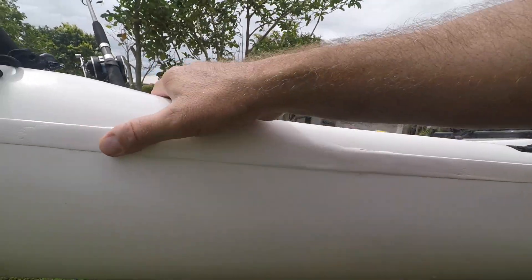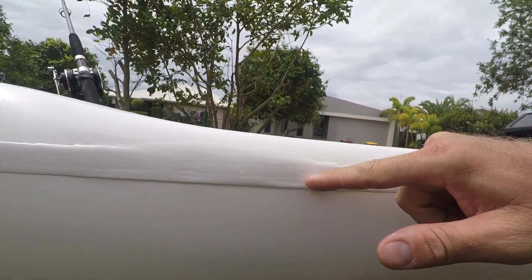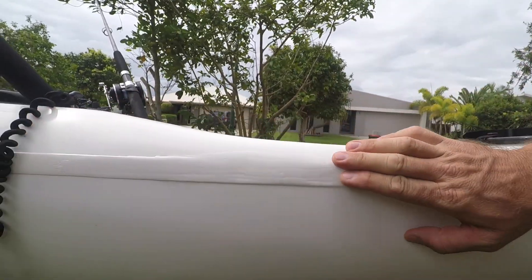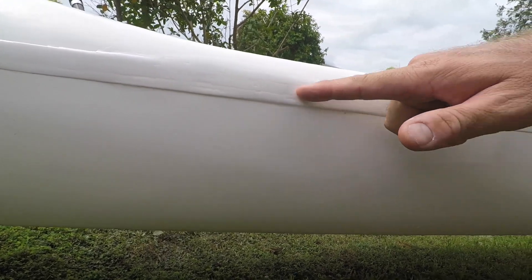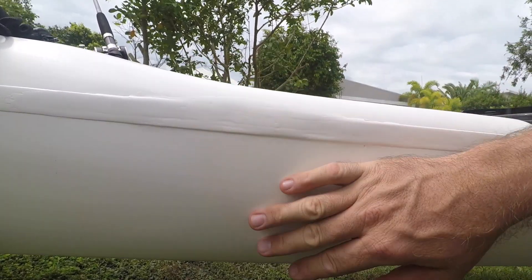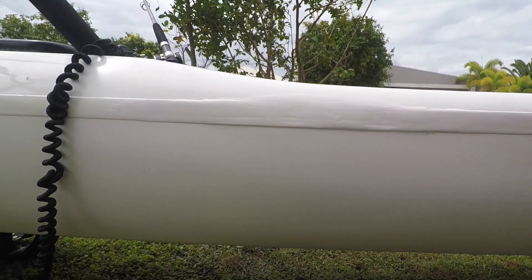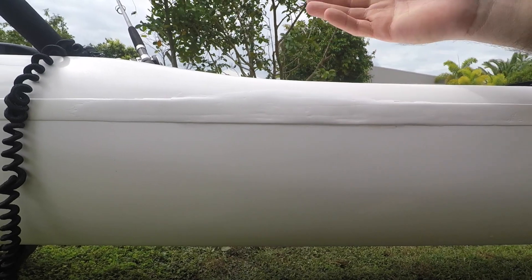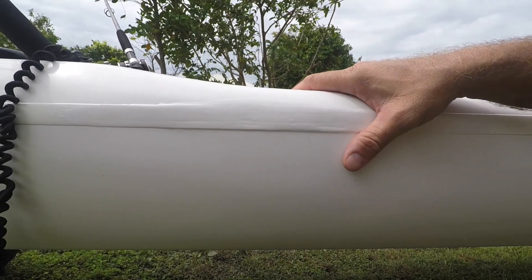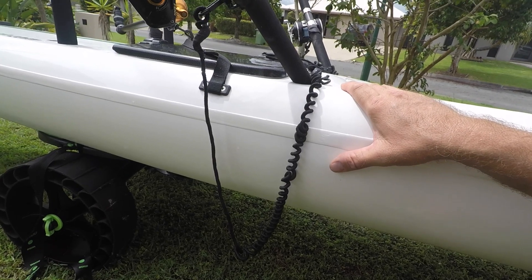This is the seam of the kayak. I actually had a crack along this seam when I bought it - I knew about it when I bought it. You could squeeze it and see a line flexing in the middle. Originally I just resined over the top without actually glassing it, and that came back to haunt me recently - the crack started to show again. This time I ground it right back, ran a couple of bits of glass over the top, applied flow coat, and fattened it up so it's a bit stronger. This is a point where there have been issues on a few kayaks - some guys have had worse issues, some minor. The majority of people are enjoying their kayak and are happy with how it's performed.